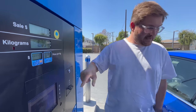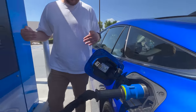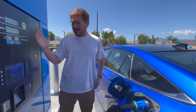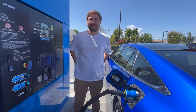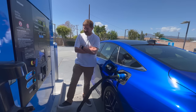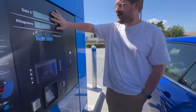Here's how much money we're putting in. You can hear all this noise — it's basically pumping minus 40 degrees Celsius, high-pressure hydrogen into this thing. This is fascinating. The Mirai has three individual tanks, all capable of handling 700 — or 70 megapascals — which is about 10,000 PSI. I'm kind of like, let's just back away from this thing a little bit. They say it's not dangerous at all, so that's good. It just feels scary the first time, like charging an EV would be. We've already put in $10 worth of H70.